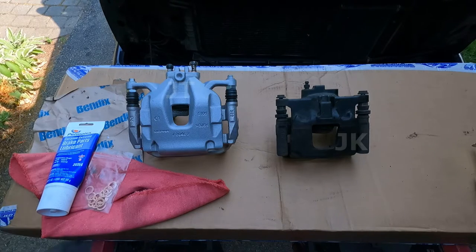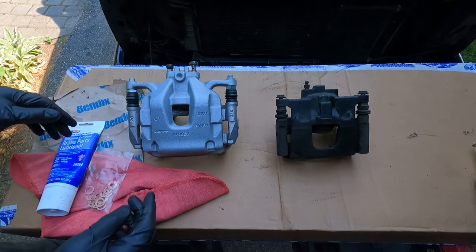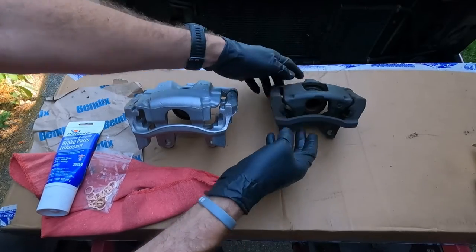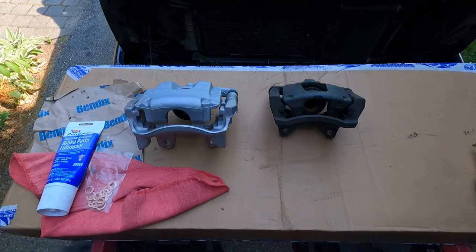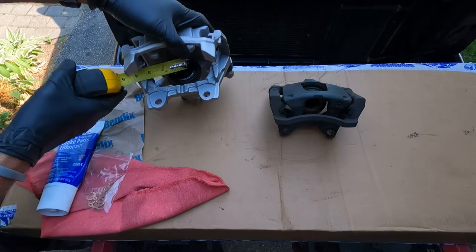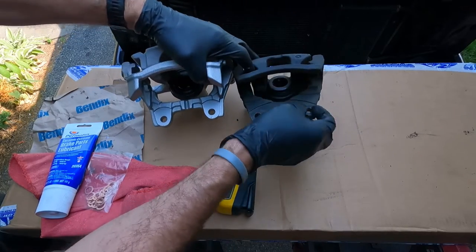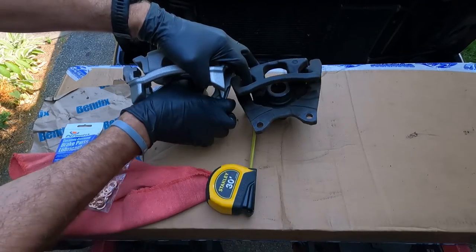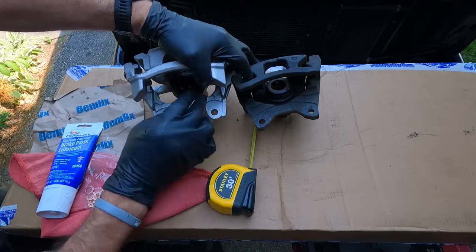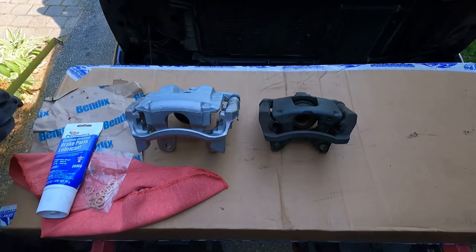Here are the calipers — check this out. This is the manufacturer's caliper and it even has the word Mopar stamped on it. I love it. For the rear calipers, both are still one-piston calipers, but I want to measure the diameter of the actual caliper piston. We'll do a visual thumb test — it's a little bit wider, marginally bigger. Visually you can see it's bigger, but look at the difference in the whole caliper size itself.